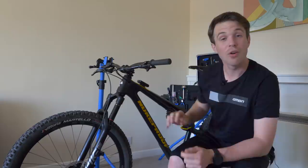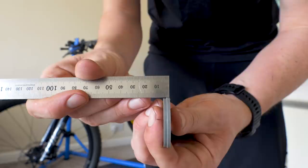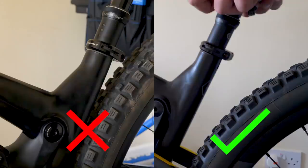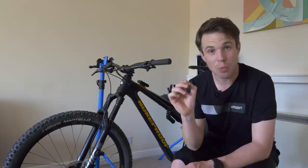Now it is time for the main event — how to make a versatile trail bike even more versatile. I want to give it the same head angle as the Reactor RS and increase the travel to 140mm at the back. The stock 5mm travel spacer and the 7.5mm XC spacer are both out of the bike to give it 140mm travel at the back. Are there any associated problems with increasing the rear travel? Absolutely — clearance is the main one. As the wheel comes up it might be touching the seat tube, so I'm going to be running it in the bike's trail mode to give a bit more clearance.